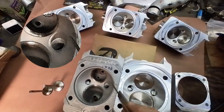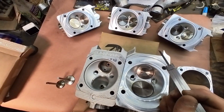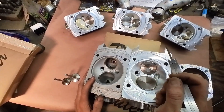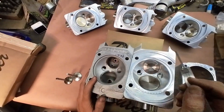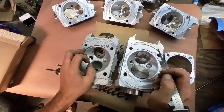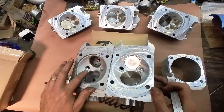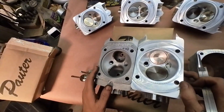Check this out — we've got a crack. Can you see that? These were just shipped to us to put flame rings in, and this head needs a repair job. That's yet one more disadvantage of dealing with used cylinder heads — these billet heads are brand new out of the box, no cracks. Looking at this twin plug job that was done: the spark plug needs to be unshrouded like the stock port. Both of these are a little tight — they could be unshrouded a little bit. At least these are radiused. These have sharp edges — that'll cause detonation. You don't want that; we'll have to fix that too.